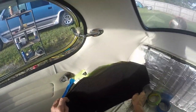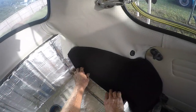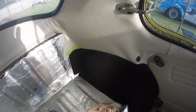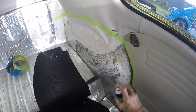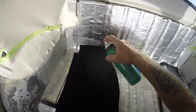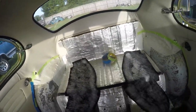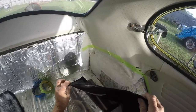Let's do the other side — I'm gonna get my tape on there, then spray the glue here, spray the glue there. Wait about 5-10 minutes. That's why you want to do two areas at once so you can get something done. I got this one kind of placed where I want it. Let's not get any glue on our door panel — tape is a good thing. All right, I'm going to wait my 5-10 minutes and be back, then put this down and get on with the package tray. All right, let's get to sticking her down.